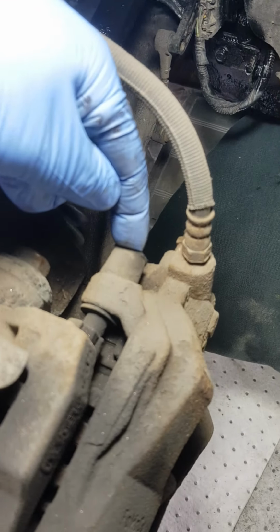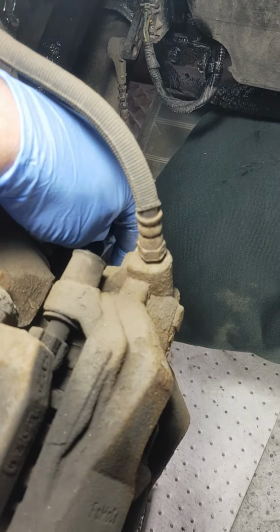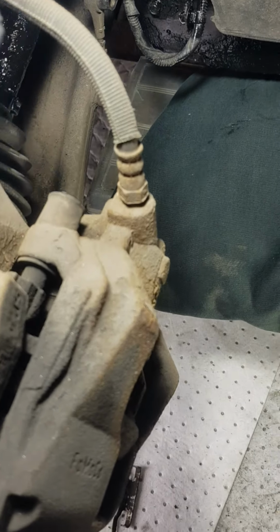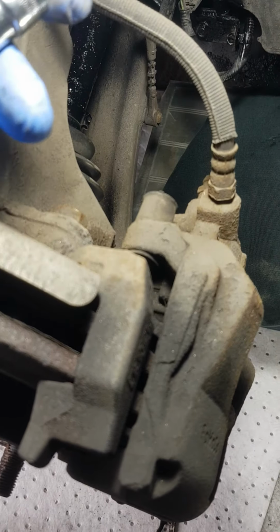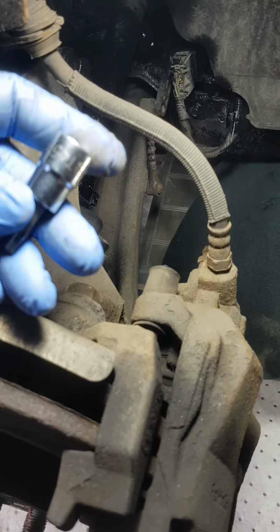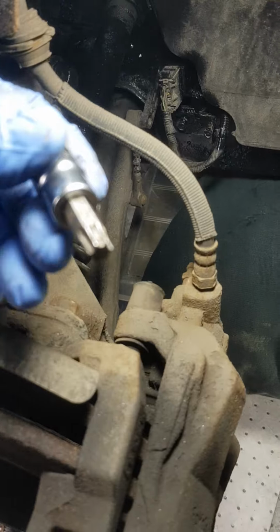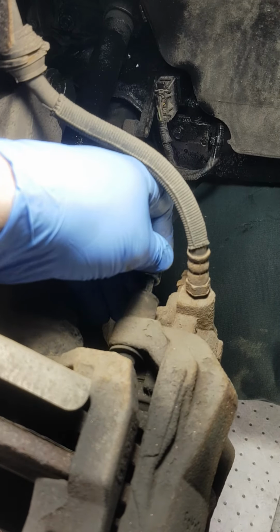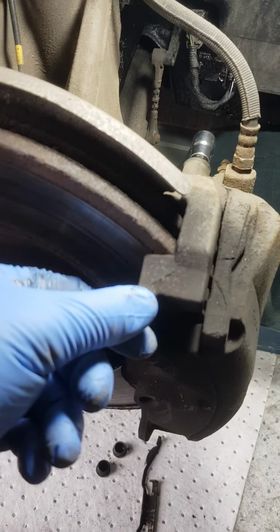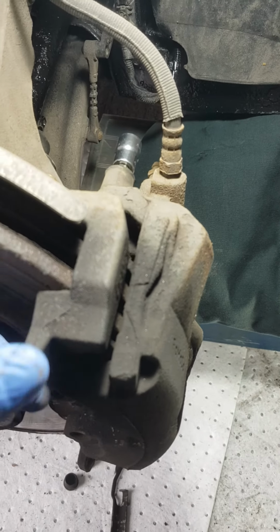You've got two. There's a rubber shroud there, and one at the top, one at the bottom, and it's got an Allen key. Now it's a funny size, like 7mm or something. So I found using a T45 Torx, because it fits nice and snug, you can undo those, and that'll remove this front bit. So I'm going to do that bit next.